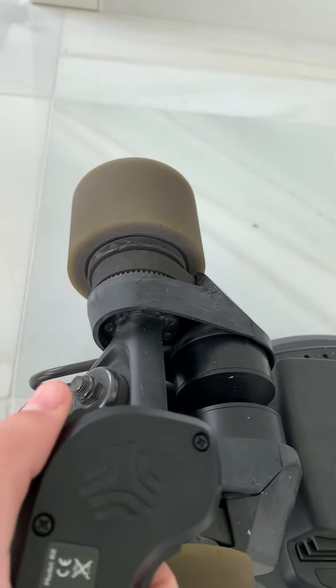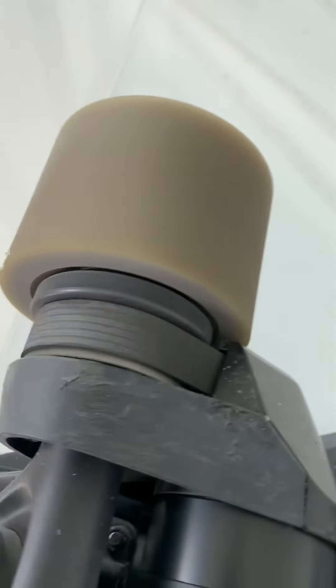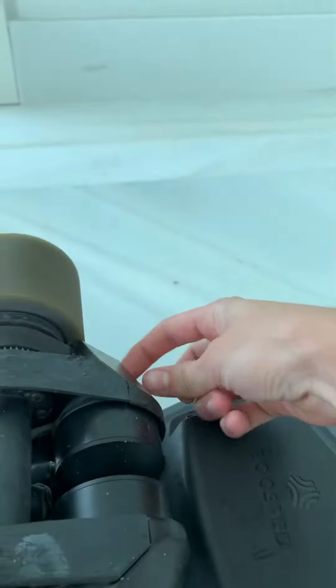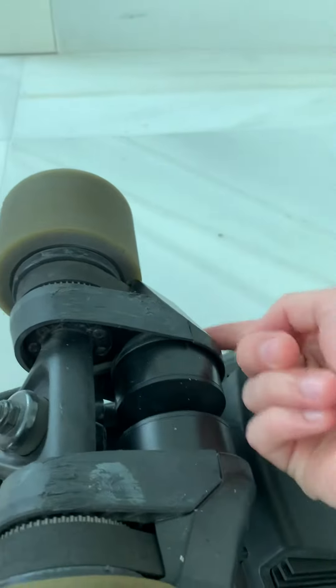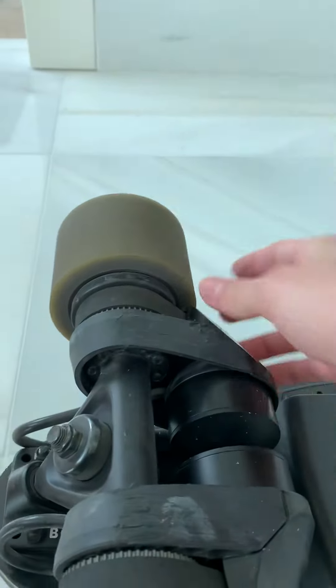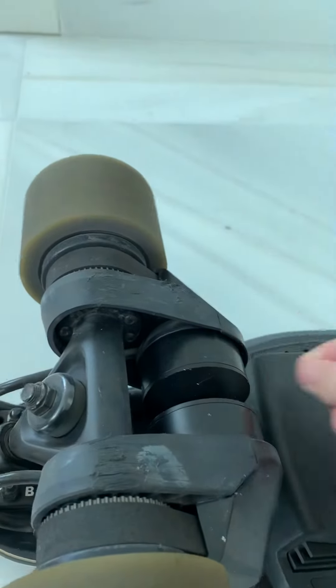That one's okay. So I took this apart and checked, and it's the same thing — there's a little bit of give on the piece that comes out of the motor. That little piece has a little bit of side-to-side give, which is what causes the clicking. It's an issue in the motor; there's nothing I can do.